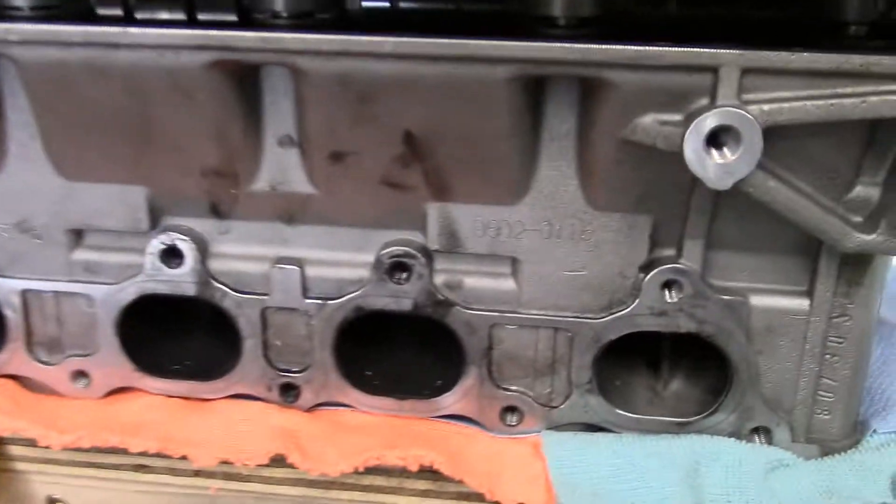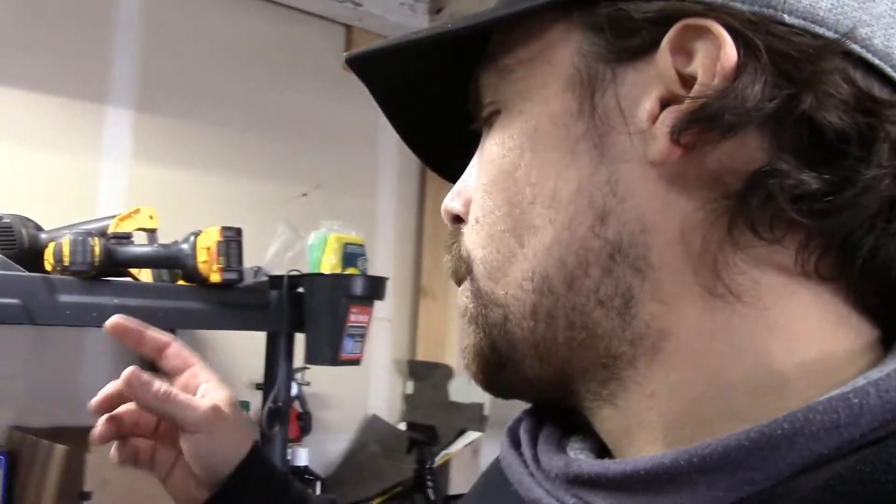Quick recap for those of you that don't know — this is my B16 cylinder head. It is not stock. This was a recast non-OEM B16 cylinder head that I got bare with the cam caps, so I put all my own stuff in it. It's got stock rocker arms and rocker arm assembly from another toasted GSR head, but other than that it's got Skunk2 Tuner 1 cams, Skunk2 Alpha series dual valve springs, titanium retainers, Skunk2 LMA deletes, Ferrea 6000 series dish valves, Super Tech seals, a Skunk2 Pro intake manifold, 70mm throttle body, and the head's been fully ported by me. It performs very well — I've never had an issue with it, it flows right.